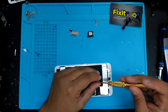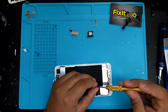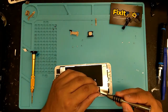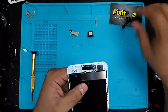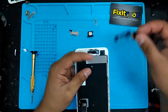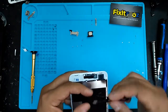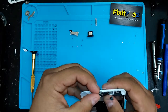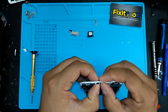Make sure you're on a flat surface when you're putting these screws in, especially for this middle button, so everything is nice and flat. This one is a regular Phillips. Okay. I always like to check the camera inside, because sometimes there's some glue on the lens and it gets all foggy. You won't notice that until later. I usually like to clean the glass here, the lens, but it looks pretty good. So now we're going to reline this up again. Put these little gold pins where the gold pins are. And the proximity sensor, make sure that fits in pretty flush.